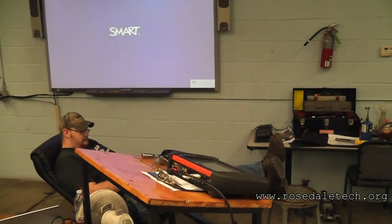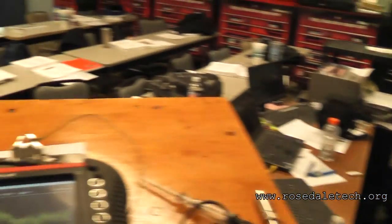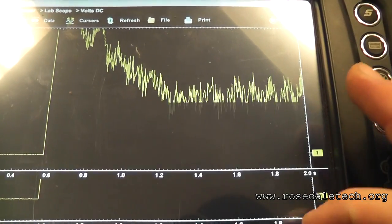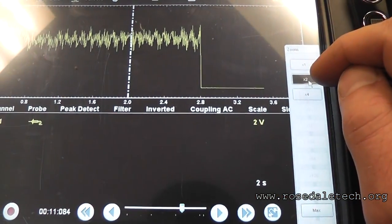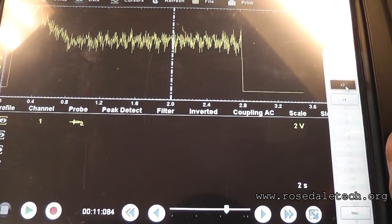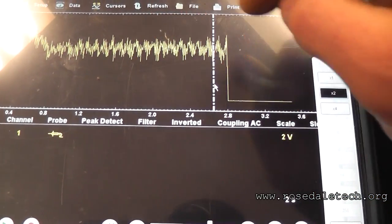Where are we at? What are we doing? I'm sorry it took me so long to come back. There's the image we got right there. That's an ugly picture. You got a lot of noise in there. Let me see your settings here. I can't make heads or tails out of it. Did you have peak detect on? We ended up having to turn it off — it was worse with it on. I'm thinking we want to filter that. Sometimes a battery charger can interfere too.